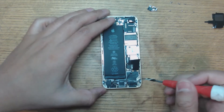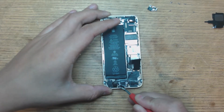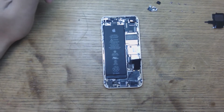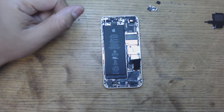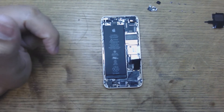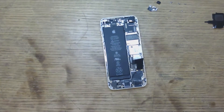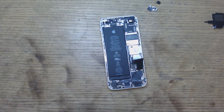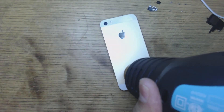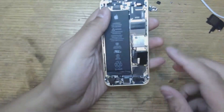Here's the charger port — it's ready to come off. Here's the microphone. You're going to need to reuse this rubber on the new charger port. There is a link in the description below — you can help me out by buying from Amazon. I usually try to get Amazon Prime links for these parts, but if I can't find it I go with whatever I can find. Amazon is really good for one-off parts. Now we're going to remove the charger port. It makes it easier if you put some heat on the back to make it easier to peel.